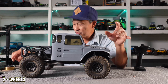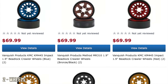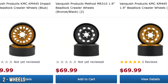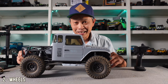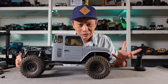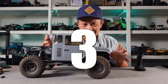Unfortunately, you can't really upgrade the plastic beadlocks — you can't put brass rings on them. So what you want is Vanquish's assortment of metal beadlock wheels, which lets you really personalize your vehicle. You can add performance with brass rings — two in the front, maybe four all around. Normally I'd say upgrade tires too, but these Falcon Wild Peak tires in a good soft compound are probably one of the best included tires out there. Maybe upgrade the foam, but in demanding conditions, go for a tire that works well in your area.